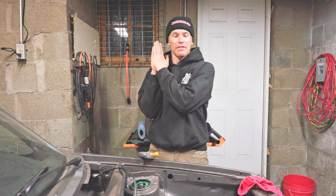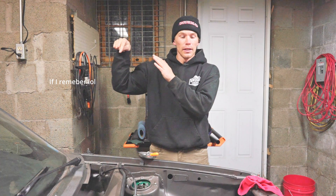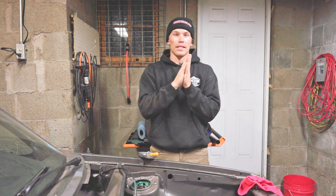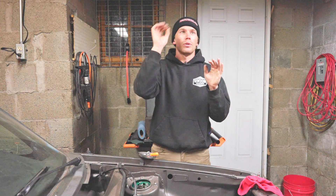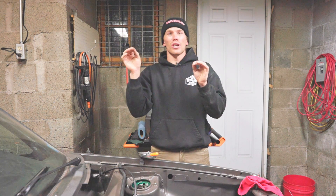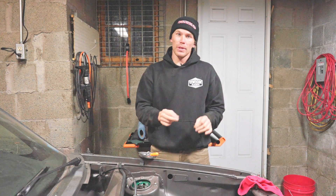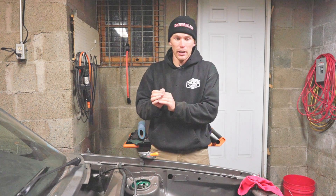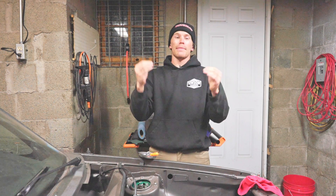In order to do injection timing you first need to set engine timing — if you haven't seen my video on engine timing you can see it right here. As a general overview: as your engine is rotating, your pump is injecting fuel, and depending on what time it injects fuel changes the performance of your car. Understanding how to time your pump is very important, and if you're a tweaker and want the best performance you should try multiple timing settings.